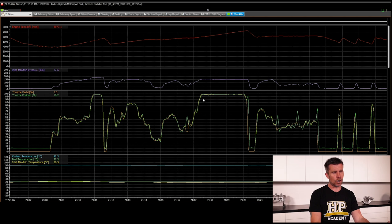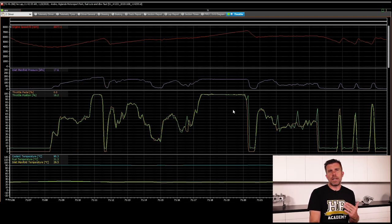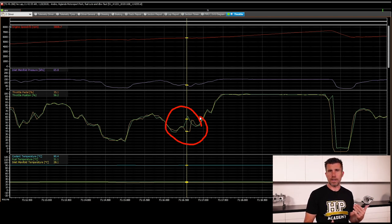This is the data from our second round of the sprint series where we decided to pull the pin because of the drive-by-wire fault. We've got some select pieces of data here in MoTeC i2 Pro software. Up the top we've got our engine RPM; the next graph shows inlet manifold pressure; and then the third graph is really what we're interested in — throttle position in green showing what the throttle butterfly is doing, and in orange the driver's foot pedal position. For the most part through this section everything's tracking pretty nicely, though even here there are a couple of little red flags. We can see the green trace bumps up to 56%, and at its peak around 60%, so there's a significant variation when I'm only at part throttle.